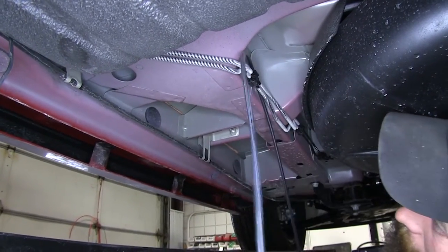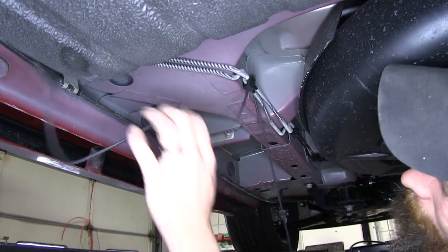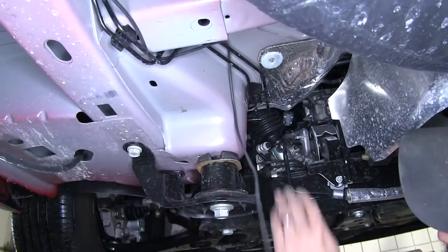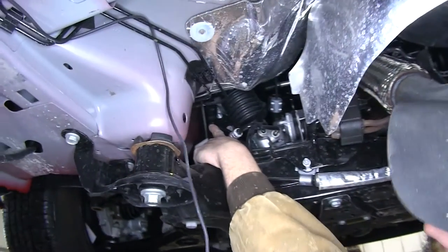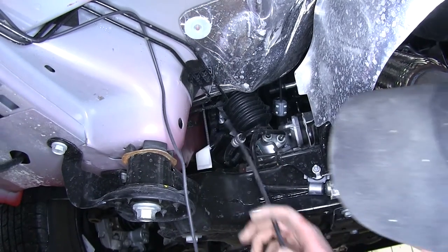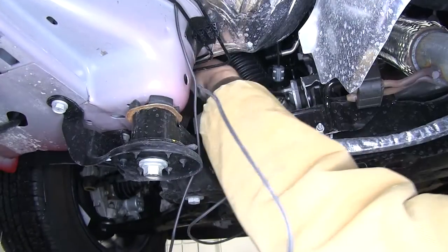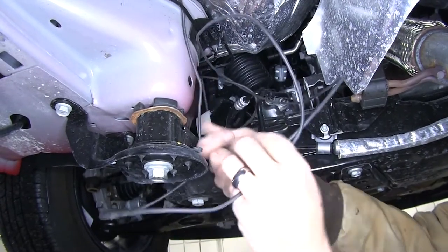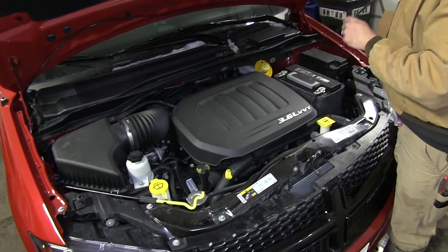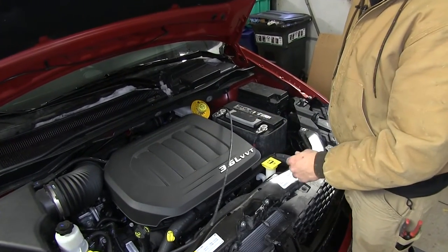The brake lines kind of make an S curve here — let's just stay right along with them. We're going to follow right up through there. You can see the brake lines go up that way towards the master cylinder, so we'll try to feed our fish right up along through there with them and get as much slack up there as we can. We followed right up along with the brake lines and came out right here above the battery. We're going to bring it right around here to our positive battery terminal.